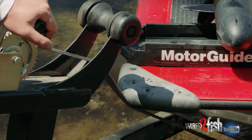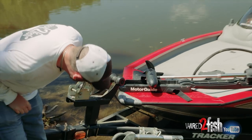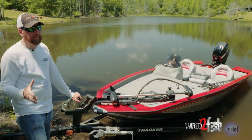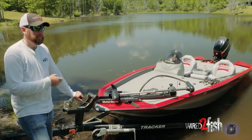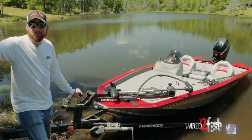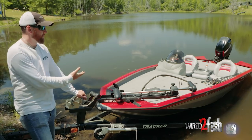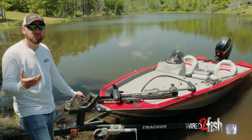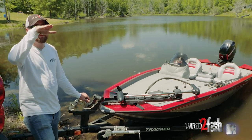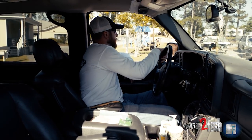This is the part that can kind of spin people out. Right now your bow is a good 10 to 12 inches beneath the roller. Instead of backing your boat off and doing it again and stressing yourself out, by far the easiest thing to do is just pull your truck up a couple of feet. Every trailer is going to be a little bit different, but on this one I'll pull it up about two, three, maybe four feet. I'll watch in my rear view, and when that bow starts to lift as I pull the truck up, I'll stop and I should be able to crank it the rest of the way up.